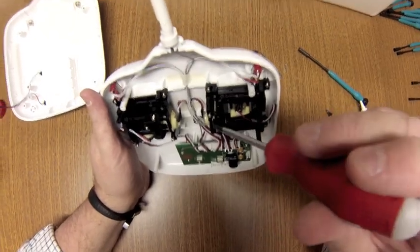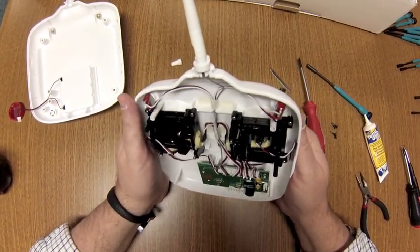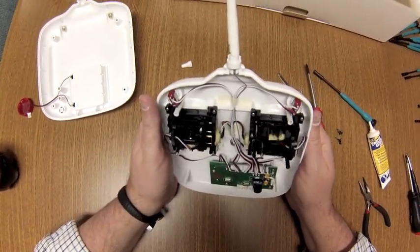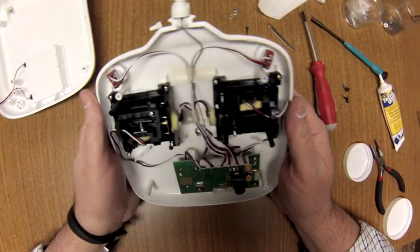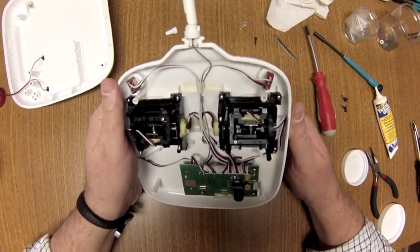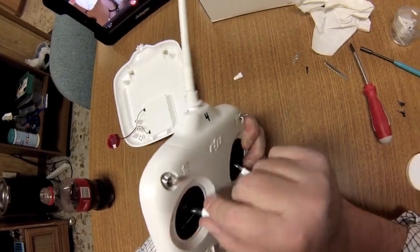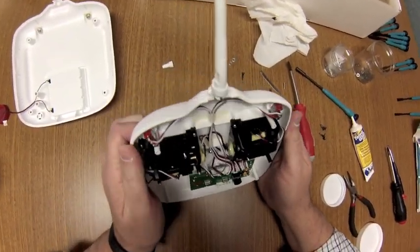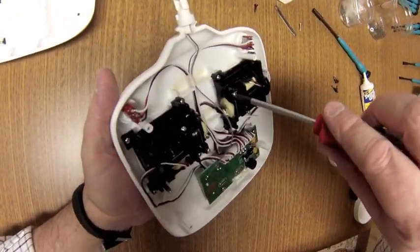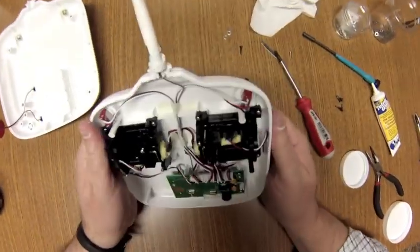of these springs. There are 3 with the Futaba heavy duty, and that gives it a very much heavier return feel on the gimbals. Alright, we have in this view the right hand stick is actually complete, and you can see that it is self-centering nicely. I think I might try to put just a little bit more tension on the elevator portion. Again, don't go too much, it will jam up the gimbal.